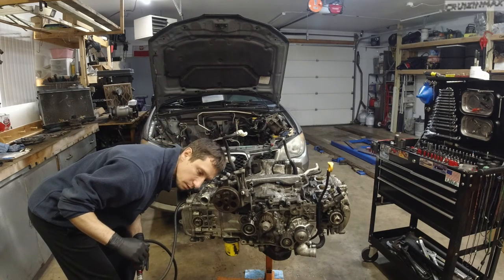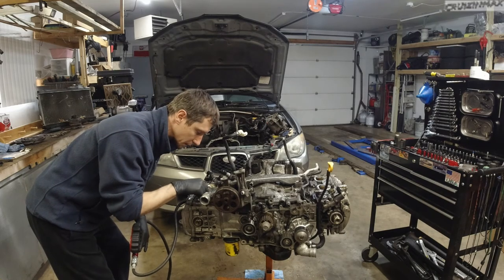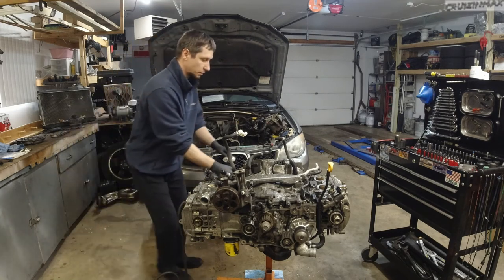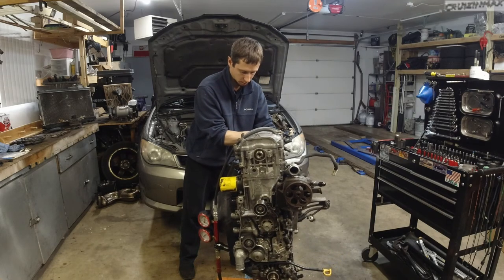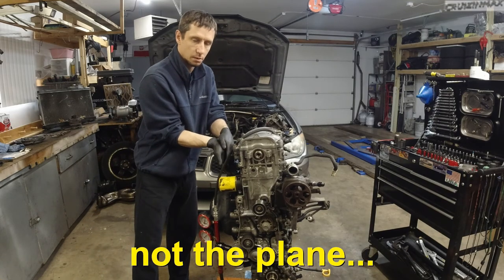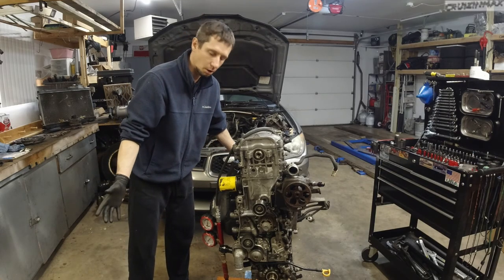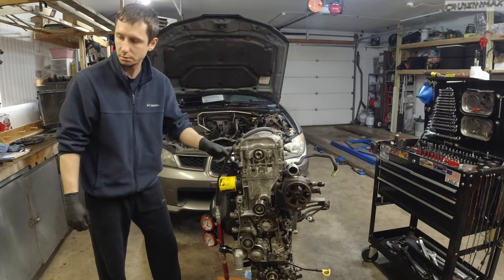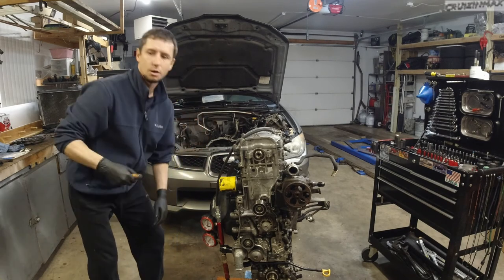Okay, so it's not the intake. I do hear some noise from number one, from this intake here, but not much. Right, let me flip this over. Can you hear that? So this means the exhaust valve is not sealing properly all the way, which is normal. The exhaust valve gets its ass kicked the most. And I already saw it through here. It's actually not that bad, so the lapping job shouldn't take long.